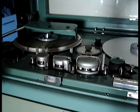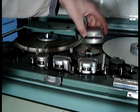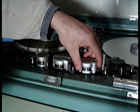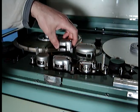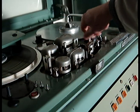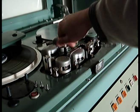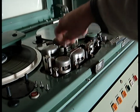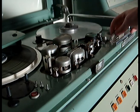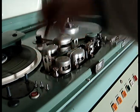Underneath the head shield, we have further more shields. The replay head has one shield covering the second shield, and inside the two shields we have the main head. The whole head block assembly can be removed so that the head can either be serviced or replaced quickly. Many professional machines have this system where the whole head block can be removed by just some simple adjustments or simple removal of some screws.